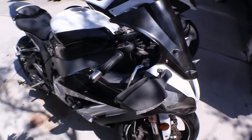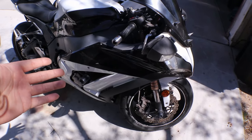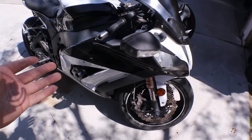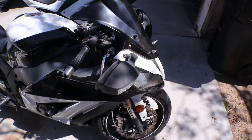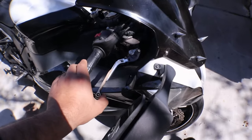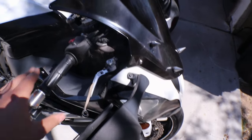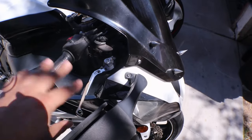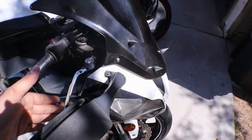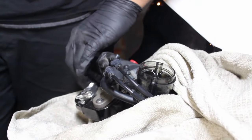It's been a little bit since I rode the bike. My girlfriend got an ear pierced and she rides with me, but she can't put on a helmet because it's taking forever to heal — literally a year and a half. So the bike's been sitting for a while, and I noticed that my brake lever was getting really spongy. I'm just assuming some air got in the system. It's not really time to bleed the system yet, but if you are bleeding brakes, this trick can also help if you're running into a really spongy lever after a brake service.